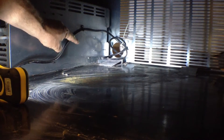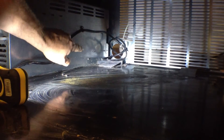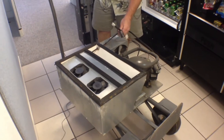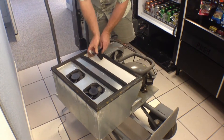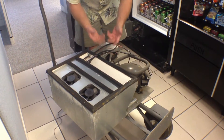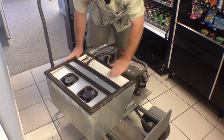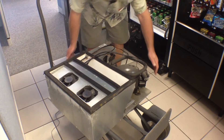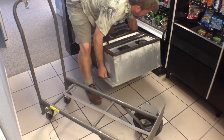As you can see in the back, this cord is in the way and may get stuck and prevent our compressor from going in properly, so I'm going to go ahead and tuck that back out through the back right now. With our replacement compressor, we're going to make sure we can easily reach our wires and move them towards the front of the compressor, where the three black knobs are that we'll use to lift the compressor once it's slid into place. Make sure we have a nice clean surface here.